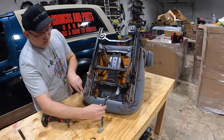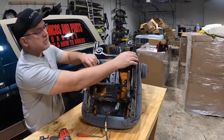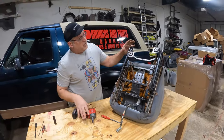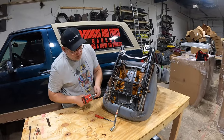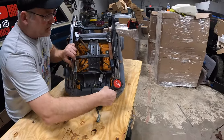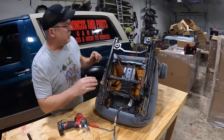The next step will be removing four 10mm bolts — two on the bottom, two on the top. You will need to slide the frame rails down to expose the top ones by releasing the adjustable mechanism that allows your seat to slide back and forth. Start with the bottom bolts and set these aside — you don't want to lose these. If you do, I do sell all these kinds of trinkety parts.